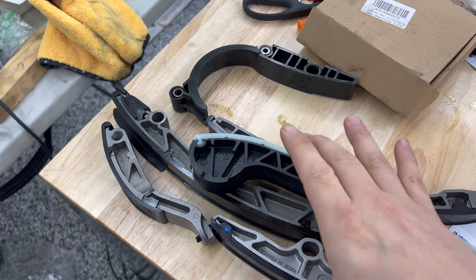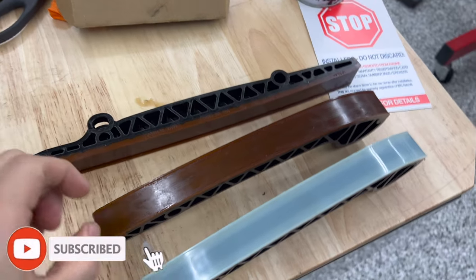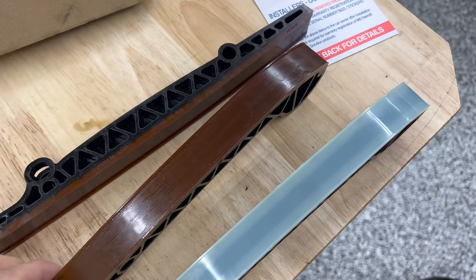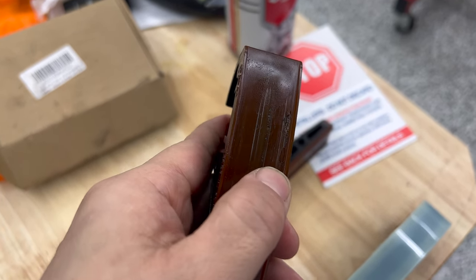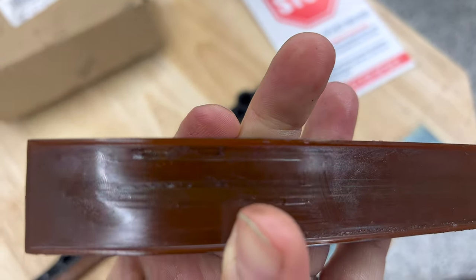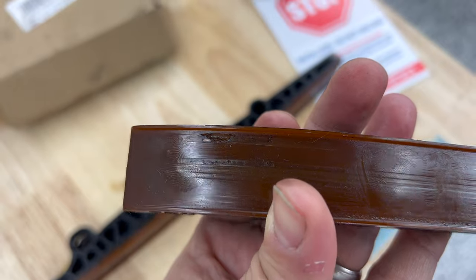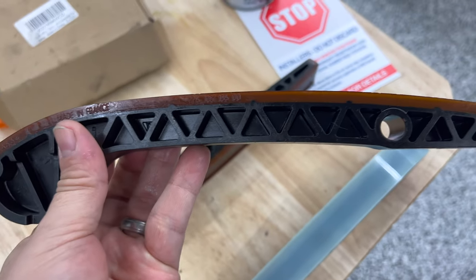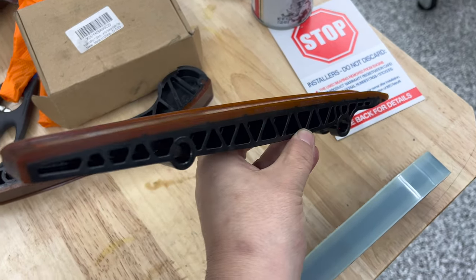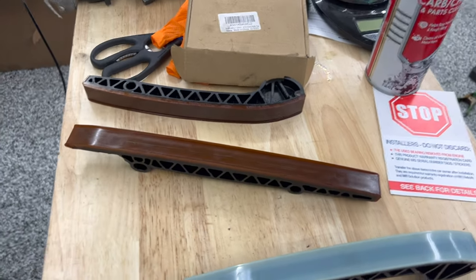We are talking about your timing and your Porsche, so think about it. I was able to find the old rails that were opaque like this at some point - this is what they look like now. But the important thing to look at is this right here - the pitting. A large chunk came out, and I do believe that little piece ended up in the sump. So keep that in mind - this is a no-brainer, you need to replace that one. And then this is the other one - looks fine to me. You be the judge.